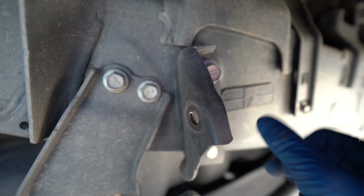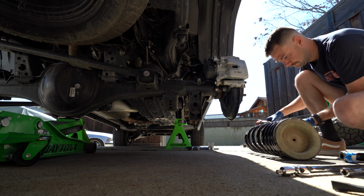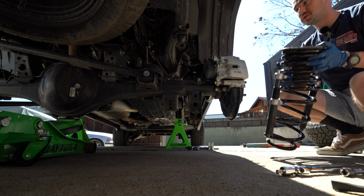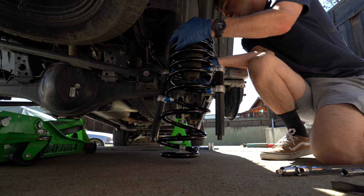underneath this sway bar bracket that mounts to the frame, this piece here. So I'm going to remove that bolt and put it back into that larger hole in the bracket, and then once we get that lined up, we're going to do a self-tapping screw into the frame with that smaller one, with these screws provided. So by using spring compressors, it should make this a little bit easier.